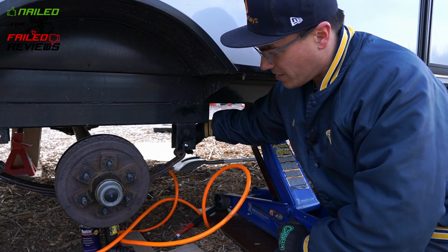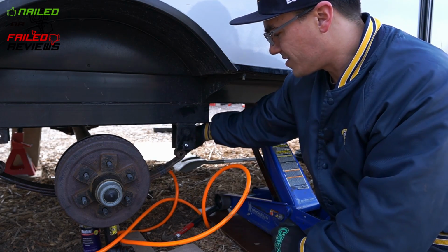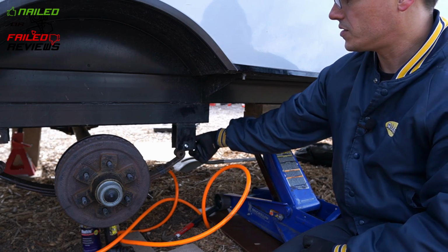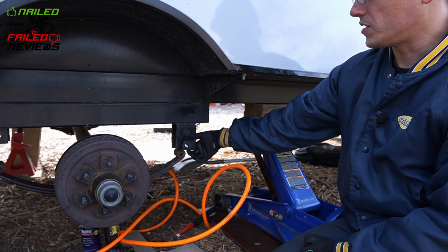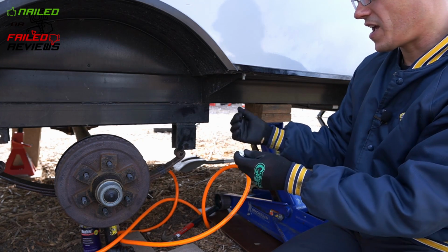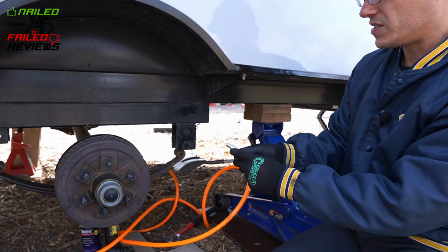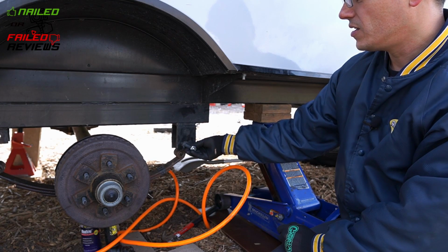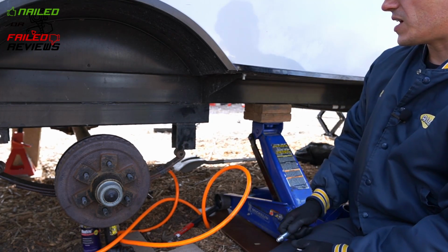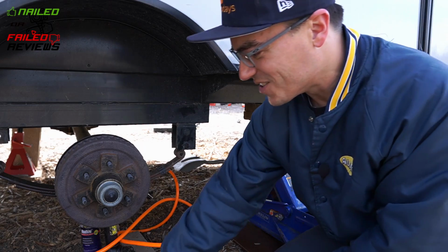Like I said, unfortunately, using these old bolts, their knurls don't do too much, just a little bit to help you get started. And the other thing is you're trying to make sure that you are properly coming through this hole, that the shoulder of this bolt isn't getting hung up on this hole, because otherwise you'll be hammering on it or pressing on it, whatever you're doing, to try to get it to come through, and it's not going to come through. Basically, this other side here barely goes right onto the outside diameter of this bolt here. So make sure you do that correctly. And the other thing, don't forget to push your spring up before you put your bolt in. You got to have your spring in place to do this.